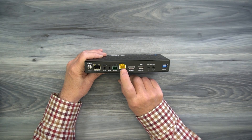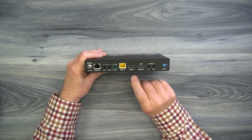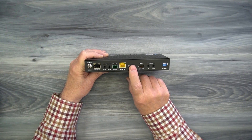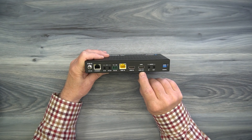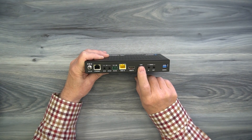This is the port where the other end of that CAT6 or CAT7 LAN cable plugs in directly. If you'd like to send HDMI information back to the transmitter, you can plug a media device in here and view it on the loopback feature on the transmitter side. To the right is an HDMI output port, which connects to a local monitor at your remote location where you'd like to enjoy the content.